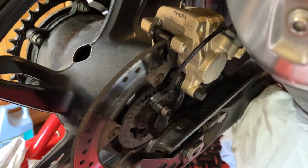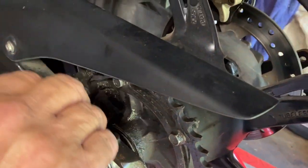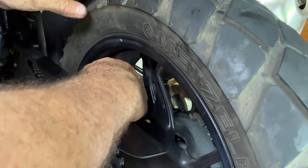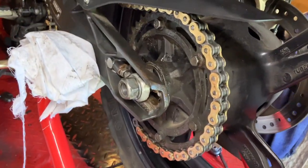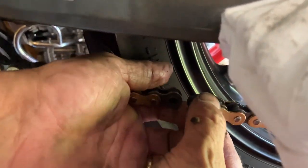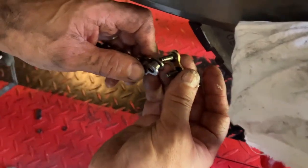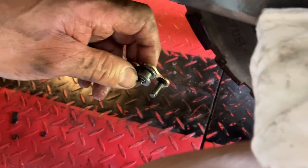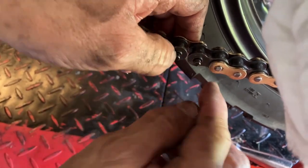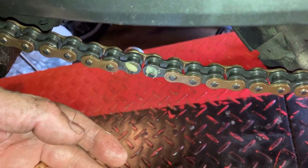It's all gone in. We're going to put the nut on the spindle, making sure you've got all the bits in. I'm just going to chuck the chain onto that sprocket and bring it around. Hopefully it's going to join up — yes, look at that! There's the link. It's got O-rings on it, so I'll put two little O-rings on and some grease. Place it in there, get the other end of the chain, put that in, then two more O-rings over there, then put the link on with some grease.